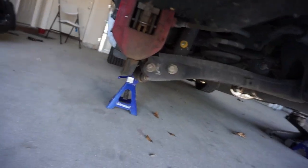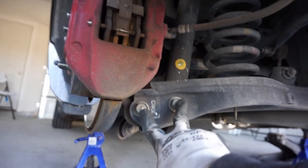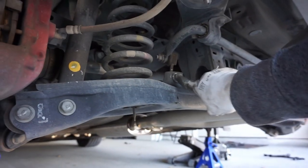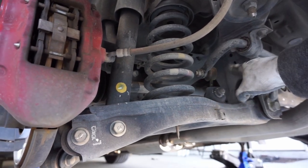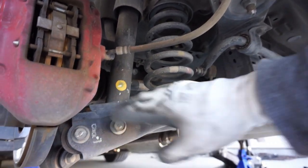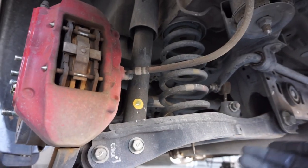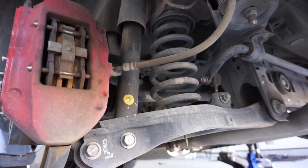For the back, it should be a lot simpler than the front — notice I didn't say easier, but simpler. I believe all you have to do is undo these two bolts for the control arm and then this one bolt for the rear sway bar end links, and then you should be able to just pry this down and the spring should want to come out. I believe that's all there is to doing these back ones, so I'm about to go ahead and try to do what I just told y'all.